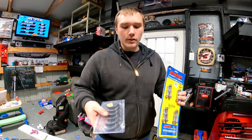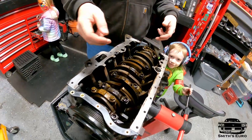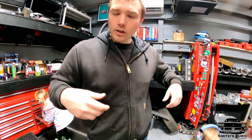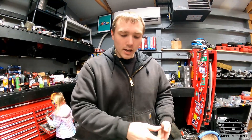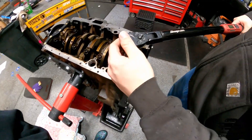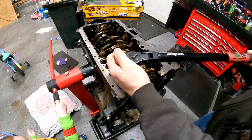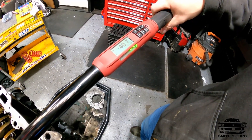I have my good torque wrench here, so when I break these original ones loose I'll let you guys see what the original torque is - it's usually 40 to 50 foot-pounds. I always replace rod bearings every time I've done these and never had an issue. You get two of them pointed up, do one at a time because the caps only go to one rod. I have this set to 40 going in reverse - first one broke loose at about 43 foot-pounds, second at about 40.7.